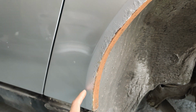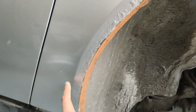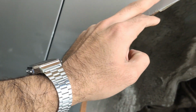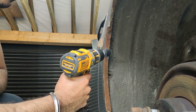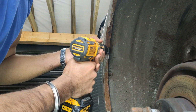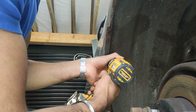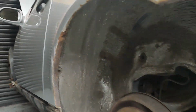So I'm going to have to bring it out, I reckon, all the way to this edge. And hopefully that edge there will give me a decent paint finish because of the light reflecting. It won't matter if it's an exact colour match or not. Sure, as you've seen, it's quite hard to control, and it doesn't matter because I've gone out just over the rust, but I need to be careful that I don't go too far into the other paint with the scraping.